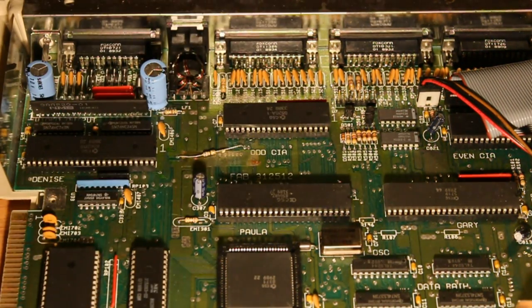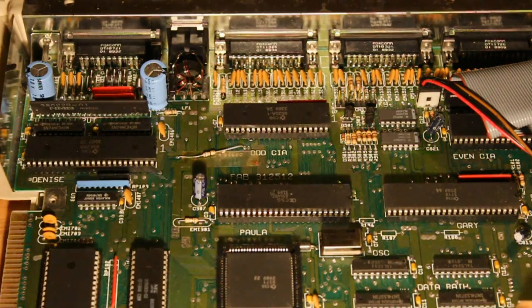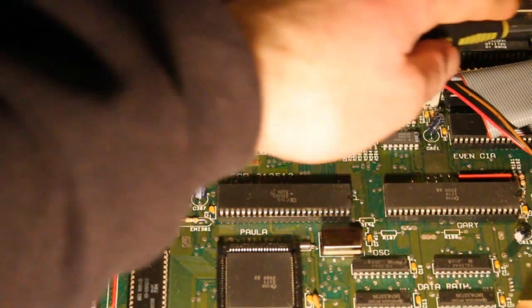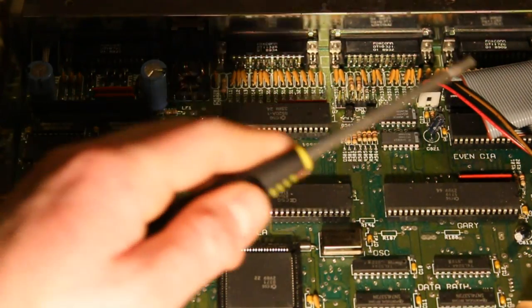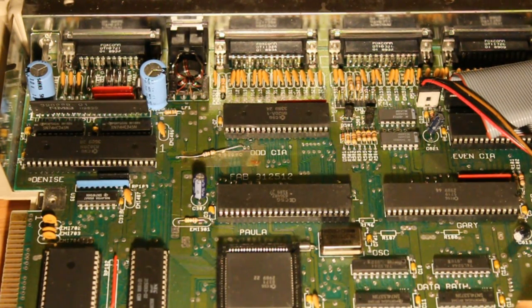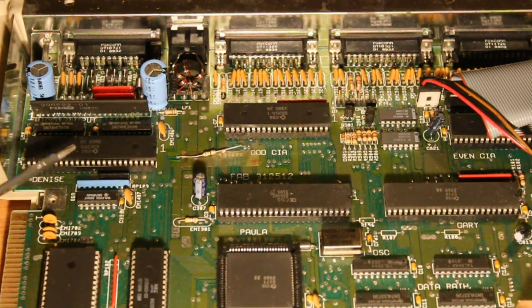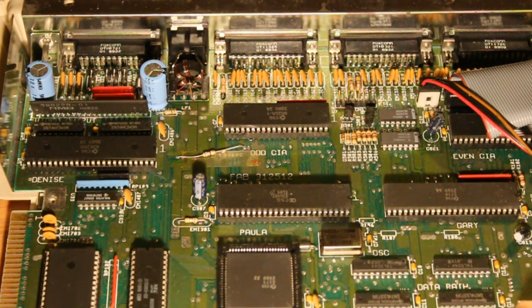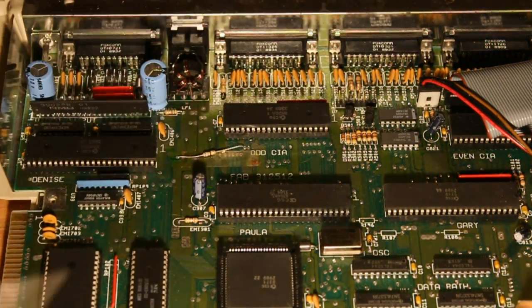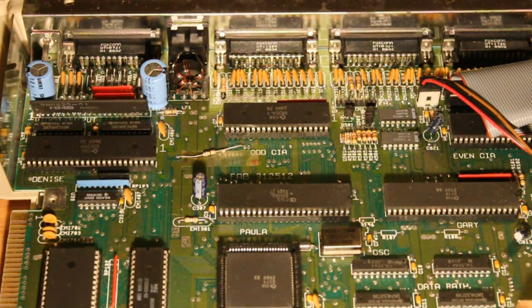The next chip here at the end is Gary. From what I can figure out from the circuit diagrams, Gary is connected up to the floppy disk and does some of that. The two joystick connectors — which are off behind the floppy drive over in that corner — are connected back to one of these general 8520 parallel IO chips. The quadrature lines for telling you what direction the mouse is moving are connected to the graphics chips and it can do the mouse as a sprite directly in hardware. The keyboard connector here connects back to one of these parallel IO chips, and the Centronics parallel printer port on the back is also connected to one of them.